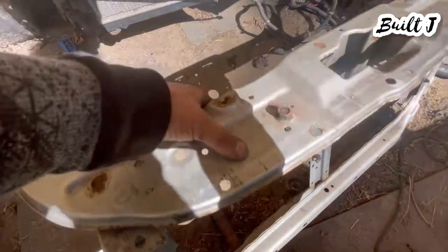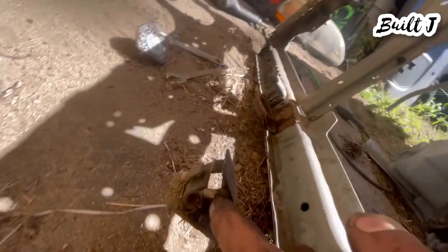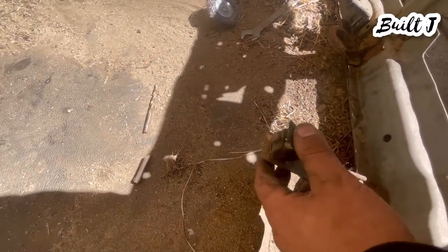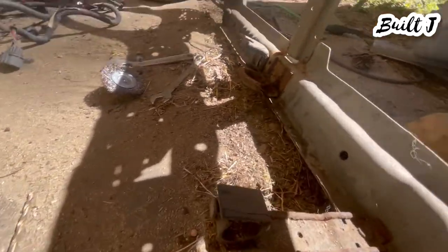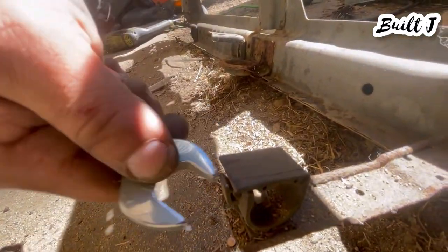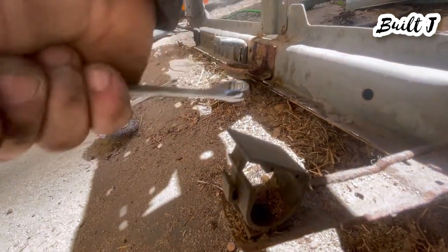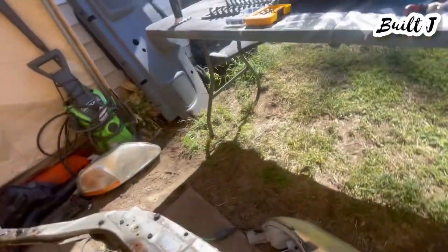She is out completely. Just disconnect that 10-millimeter and you got your wire harness over here. If you do have your AC setup still here, don't forget to disconnect this. I forgot to disconnect it and it was clipped on — it just clips in, and you want to remove this clip outwards and it should pop right up so you can remove it.